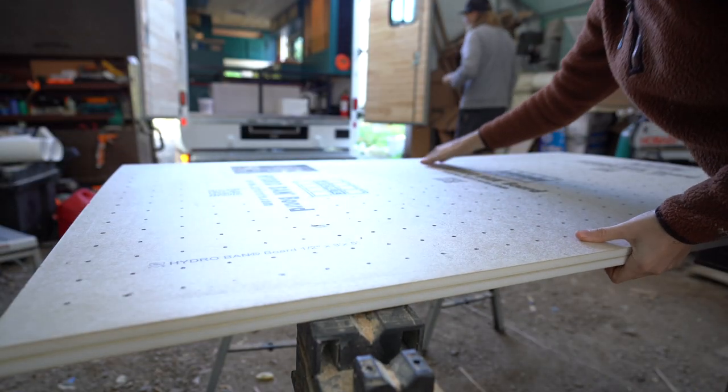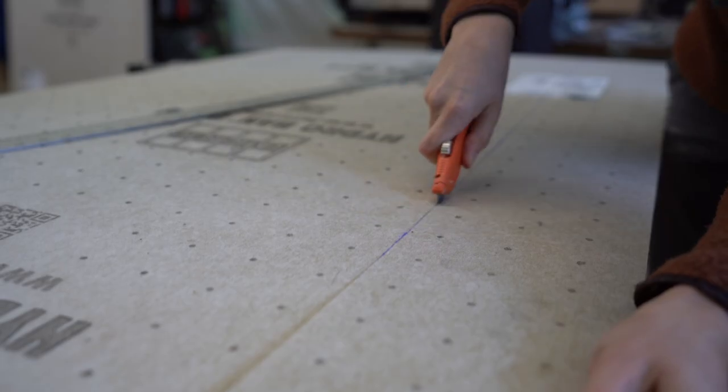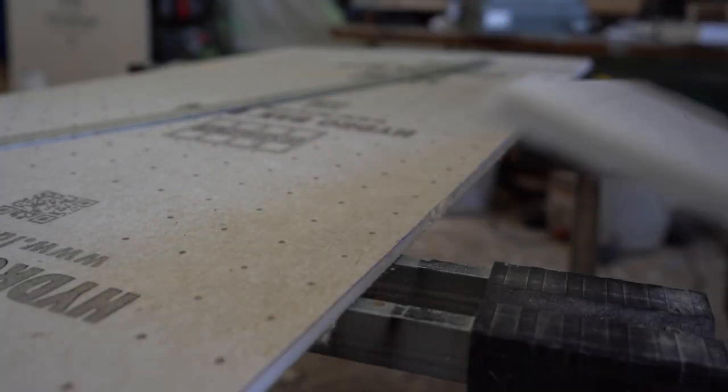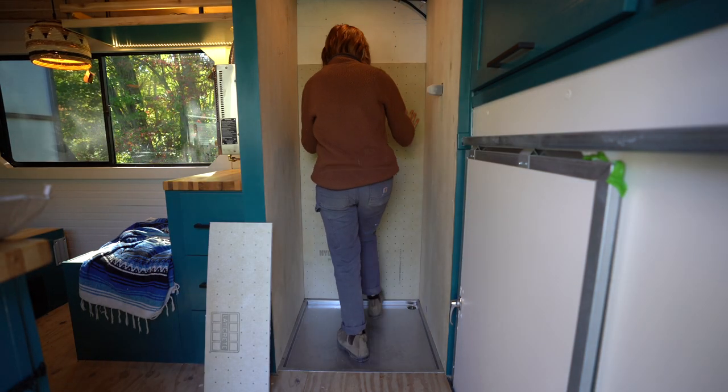Just like our other shower installs, we are going to do tile on the back wall and FRP panels on the side walls. We like this setup because we're able to still do tile but save weight with the two FRP boards — it would be a significant amount of weight if we just tiled the whole stall. So just doing the back wall allows us to get that pop of color but also keep it relatively lightweight. We like to use a lightweight tile backer board. There are several brands we've used throughout the years, but this year Hydroban is what was available to us. This is a great product to use when tiling in a vehicle because it is lightweight — it is just foam, it's easy to cut, easy to get up onto the wall, and you're not adding extra weight to your shower.